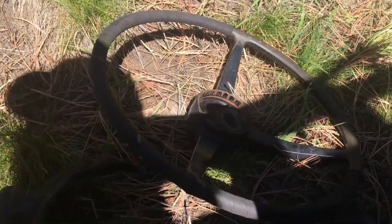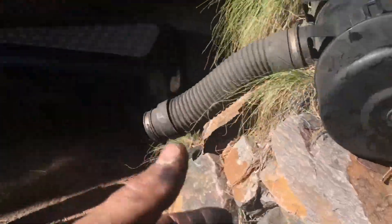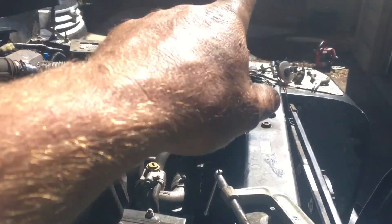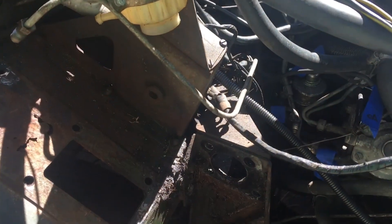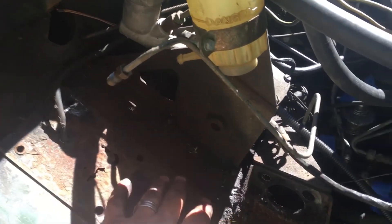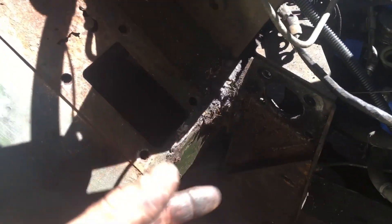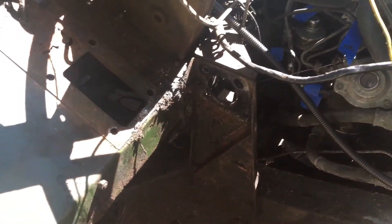The goal is to use the factory Series 3 steering wheel, but a Defender steering wheel will also fit. I have the linkage and the power steering box from the UK, and we're just cleaning that up now. I had to remove the brake pedestal to give myself enough room to get it out — it's a method of very carefully rotating it up and out, and that's how you bring it out in reverse too.